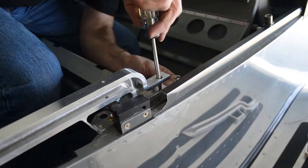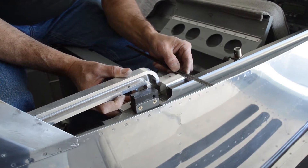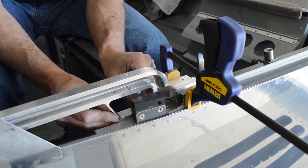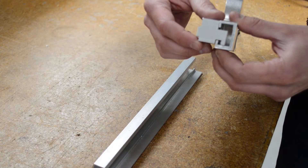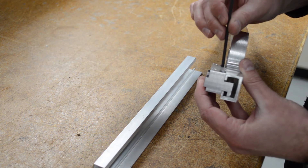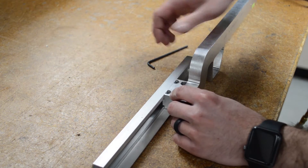The next thing you're going to do is install the S-Tracks, but before we get there, let's take a little detour to talk about the spacer block. We've included a machined spacer block in the kit to make things a little easier for you. This spacer is designed to be a starting point to help you get the tracks aligned and properly spaced, but you'll need to test and tweak to get things to fit perfectly for your install. You'll probably need to take out the aftmost canopy track screw so that it doesn't interfere with the spacer block. Place the side with the extra angle into the S-Track and slide it into the straight section of the track. You can turn the screws counterclockwise to take up some of the vertical space between the spacer and the track, but don't turn these so far that they clamp the track or move the track away from the block. Place the other side of the spacer block into the existing canopy track and do the same with these screws.